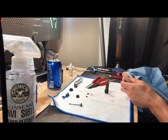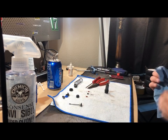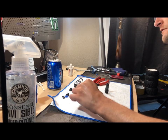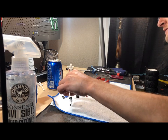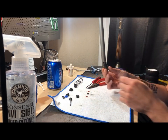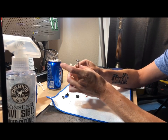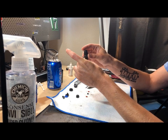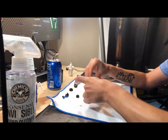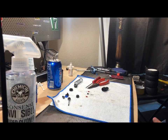Once that's cleaned out, what's going to be sliding off here is going to be completely different - everybody's different. This is just how I run my shock setup. This is a shock limiter - it goes inside the body, under the piston. What it does is it limits how much it can drop out - that's how I change my droop. Everybody has different settings or different ways to change everything. Some people will use droop screws, some people will use shock height on your shock towers. I keep my shock towers the same and just change everything in my shock.